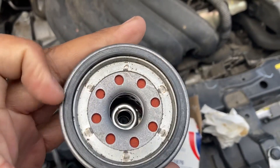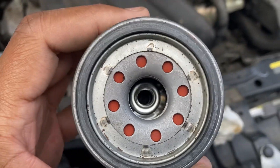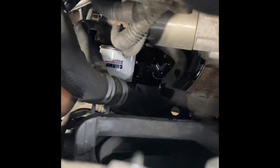You're supposed to put some oil on the gasket so this thing don't get stuck and stay on the engine block. That thing ain't got no oil around there — I'm not going to do all that, but you can do it if you want to. So that's the new oil filter. You want to start it by hand — it's supposed to go on there real simple and easy. You can take one finger and spin it. Just spin it, and you want it a little bit past hand tight. You can hand tighten it, but you don't want to monkey tighten it. Don't make it hard on yourself. I do mine hand tight, as tight as you can get it with your hand.